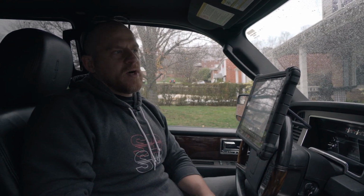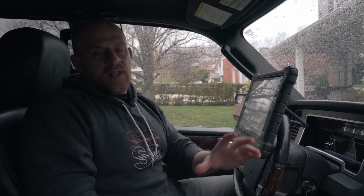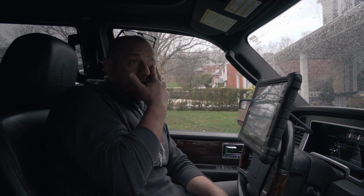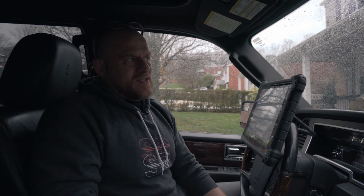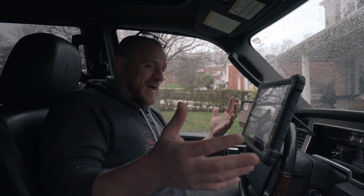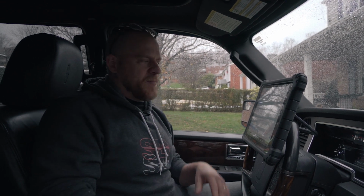And then I think the last thing I'd like to do with you guys is let's go in the studio, and I want to talk about the flow chart that Ford wants you to follow with this blend door problem when it doesn't move, and see if we can tie up the loose ends there. There were a couple of tests that you might want to consider doing before attempting an 8-hour dash removal job. Let's go in the studio and talk about it.